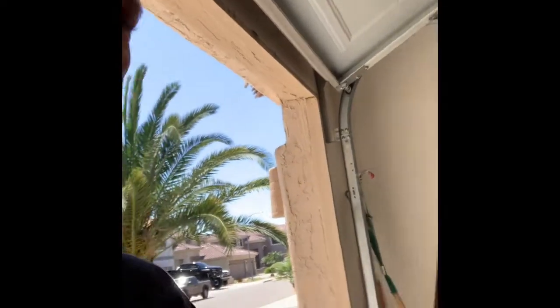This is the can of rust reformer that I use, and the brackets that I'm referring to are these type brackets here. These go on the inside of that metal, and then they attach to, they connect to the metal trim, then they attach to the tailgate, and then you bolt them in from inside the tailgate after removing the tailgate panel on the inside. I'm going to spray these down with rust reformer and then reattach them back to that metal trim you see right there.